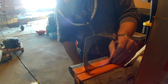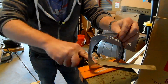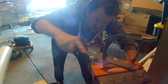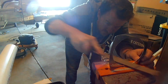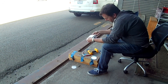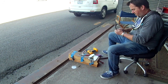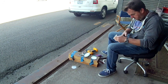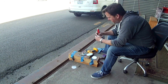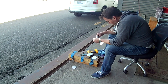I don't have a hole saw that's like four point eight five inches — it's ridiculous. After you've got them all cut, take it to the vice and do some sanding. That secondary piece is the bracket that sits on top of the light and holds it in place. I cut some spacers out of some stock. I also put some high-temp RTV on both sides of the bracket where the light's going to rest, just so it's not clanging against metal the whole time, because that'll eventually wear something out.